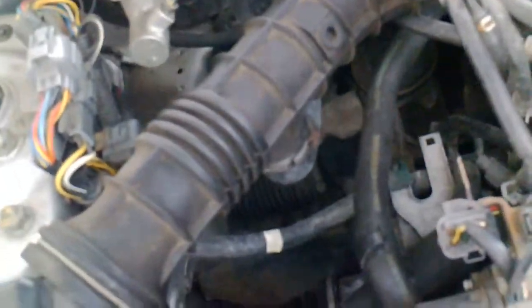Anything that might not be working — first port of call for headlights, always be looking at and checking the earths there. We've got an earth, we've got a test light on there. Anything that doesn't light, you need to be aware of what should light up and what shouldn't. Anything that's connected electrically — for example the alternator case — should light up.